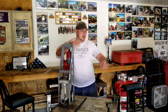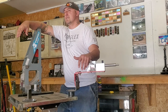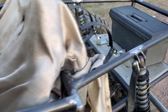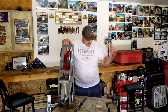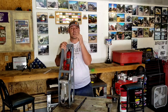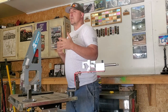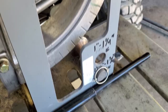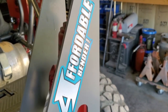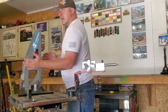Day two into chopping up and rebuilding this cage. I tried to save you all a little agony because I was grinding on that thing for a solid five or six hours between my seven-inch grinder, four-and-a-half-inch grinder, a flap wheel, and even my die grinder to get into tight places. I am excited because today we're actually going to bend some tube. This is an affordable bender — I've had this thing for quite a few years now. It has worked great for a hobbyist that does two to four cages and bumpers a year max. If I were to use it a lot more, maybe I would change this jack out to an electric or air-operated hydraulic jack. One downside is it only has a 90-degree bend on it.